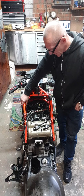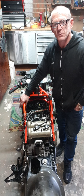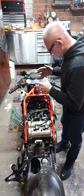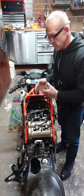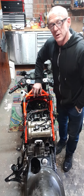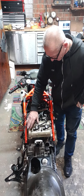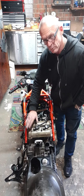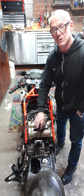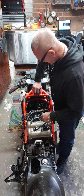The thing that gets me about this is the bike's not throwing up any codes, no errors, okay? I'm going into the program, there's no errors. So for there to be no errors, it's obviously something just awry. Something's touching, or a fuse, whatever. All the fuses are fine. If there were errors, believe you me, I'd be looking them up. But there's no errors. So while we're ticking along, I haven't cracked anything. I did take one rocker tower off just to have a look, and while I was there, I checked the valves, the valve seats, and they're all right.